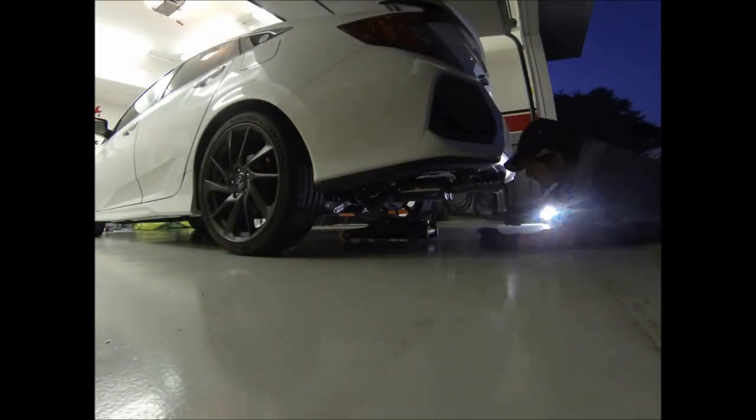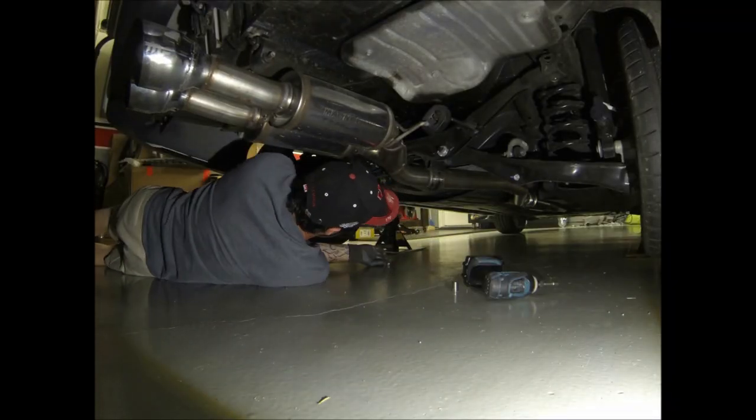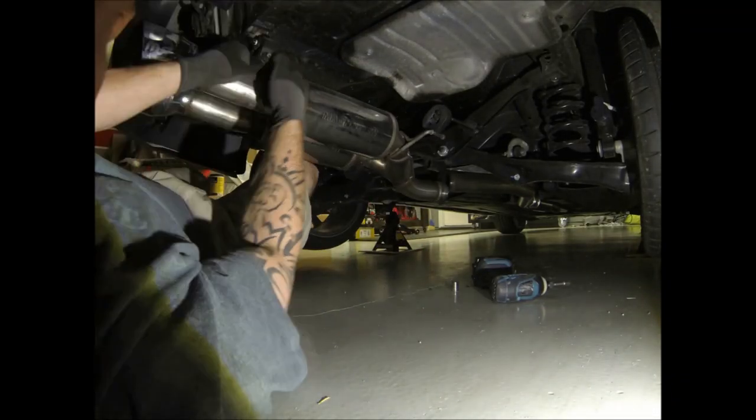The far easier solution is to swap out the mufflers with bigger ones. Yes, I know a bigger resonator will do a better job than a muffler, but unfortunately the underpan and heat shielding are very specifically shaped, so space is at a premium. Out back of the car, however, is a totally different story. The considerably slimmer design of Magnaflow's system leaves plenty of room, so bigger mufflers are definitely the way to go. I'm going to get Miss Vicki in the air and pull off the rear section of the exhaust — grab a pair of safety glasses and meet me over at the bench.